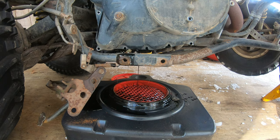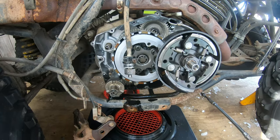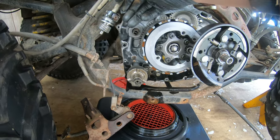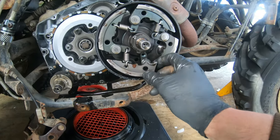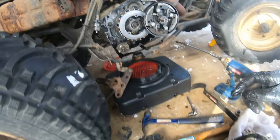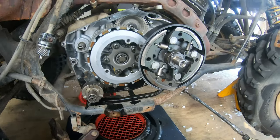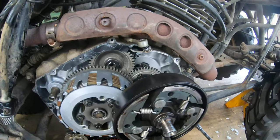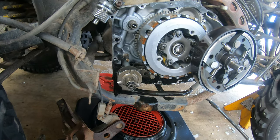I just split open around the clutch. Still plenty of oil in there, interestingly - I thought all the oil was out because I had drained it out around the filter, but still some sitting in the bottom. I just pulled off the clutch cover. Here's the speedo cable. And I am a little excited - that's a blown up clutch. That clutch right there, centrifugal plate, snapped right off. One of the springs is down in here. We may have a blown up clutch, and if it's a blown up clutch, we don't have to take the motor out.